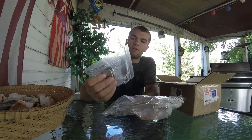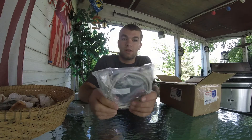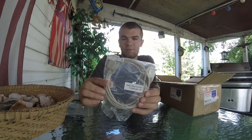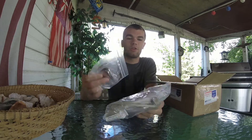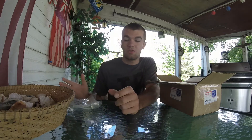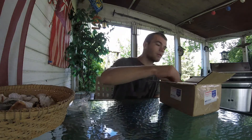I'm not entirely sure what this particular piece is for — I'll figure that out later. This is what you use to plug the Megasquirt into your computer to tune with. There's supposed to be a USB adapter in there as well, but if it's not included I'll just order a USB to DB9 adapter. I have to order a voltage regulator anyway, so it's not a big deal.